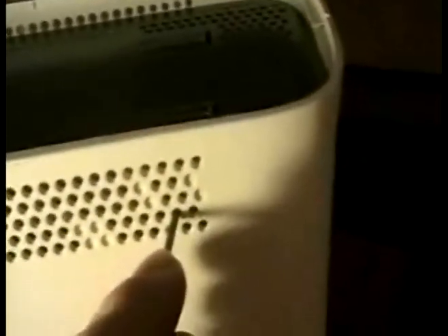This is the second of the flat head in the precision screwdriver set — the small precision screwdriver set. You want to put that in right here, then right here, and over here. Sometimes there's one right there too. Put this precision screwdriver in right here and press those in — it should pop the hard drive side out, like this.